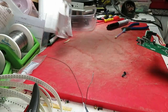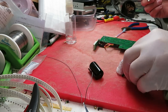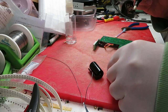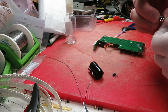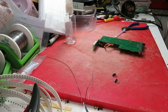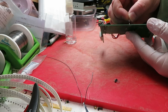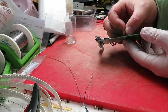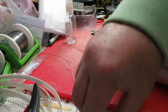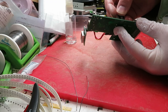Now we're ready to drop on the next set of pins. I'm going to flux that up - flux the pins. I recommend always fluxing pins when you put pin headers in, purely because you'll be soldering away and then suddenly one will just not want to solder. You'll end up melting the entire area just to get it in. So save yourself grief - use a bit of flux. I'm going to pop them in there and use a little bit of scrap female header to hold them together.